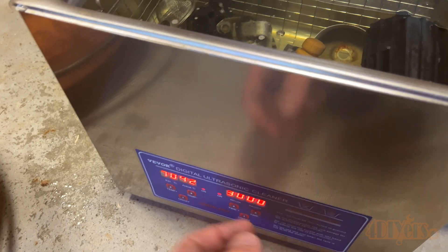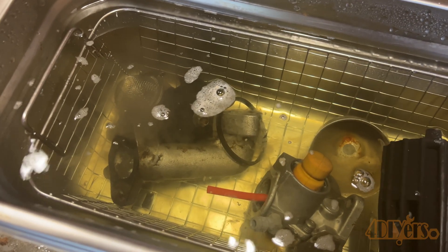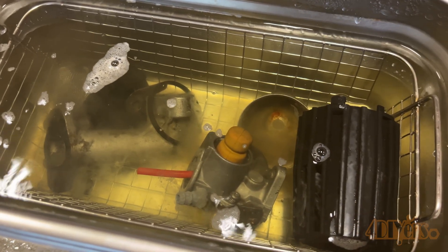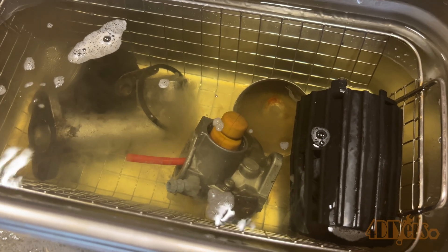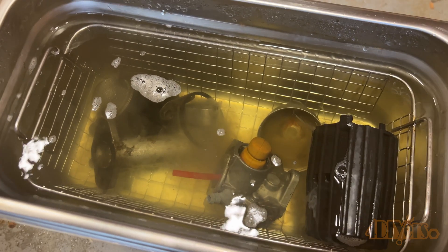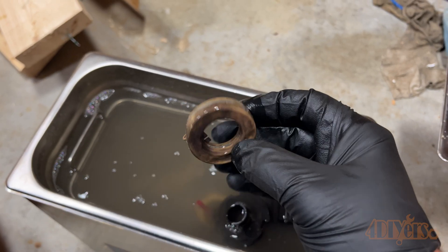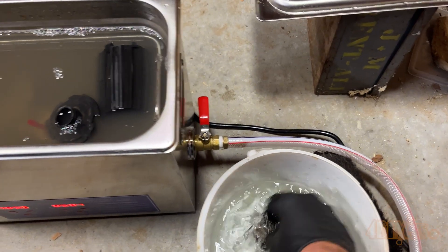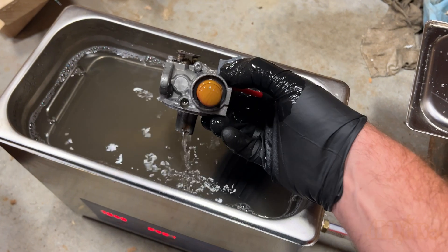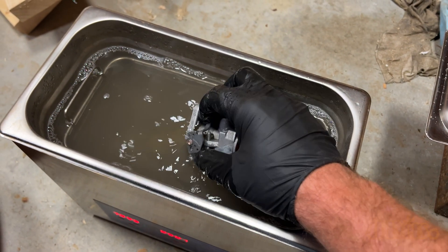Make sure you are working in a well ventilated area as the smell can get quite strong. Then the ultrasonic cleaner is turned on along with the heating element. As you can see once it's activated, the cloudiness in the water is any debris coming off. This works on a 30 minute interval — depending on the state of your carburetor you may need to have it run for one to two hours. Once it's done you can remove the carburetor and its components and then rinse off with clean water. Some carburetor examples in this video do have a sticky linkage and it does seem to free them up once it's in the ultrasonic cleaner.